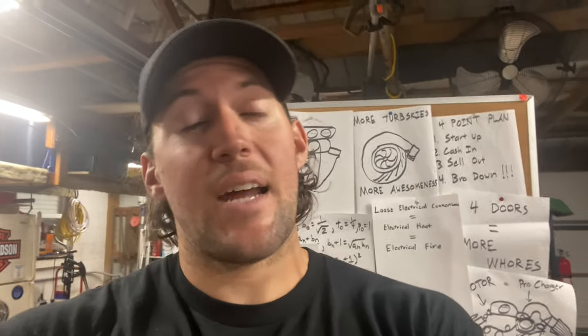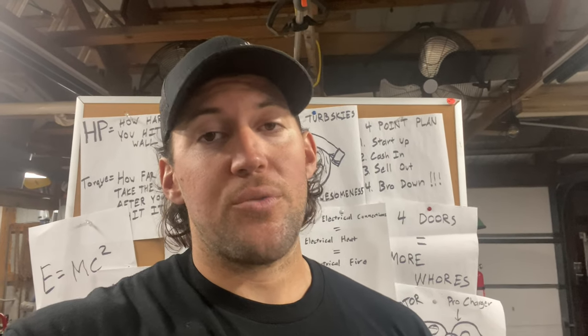The mad scientist just called me - he has a camera system as well, might be a smaller diameter, so still a little bit of hope. But no matter what, the engine's gonna have to come out. JH says he's pretty sure we're not going to be able to see it - these injection holes on newer model trucks are just too small. He doesn't think I'll be able to see the cracked piston without pulling the head, and that's not something I'm prepared to do outside in the elements with the engine up in the monster truck.